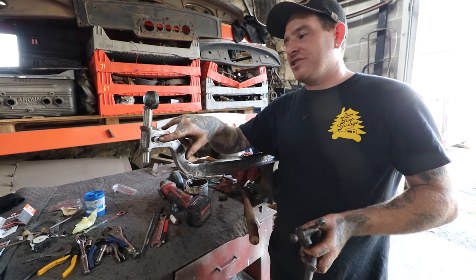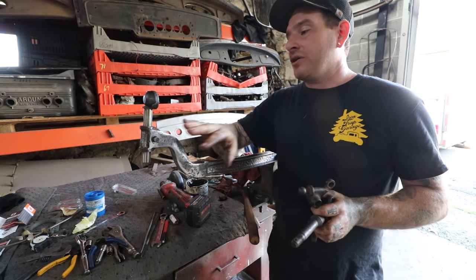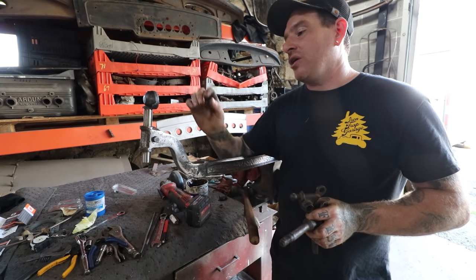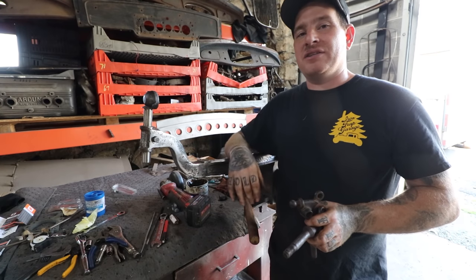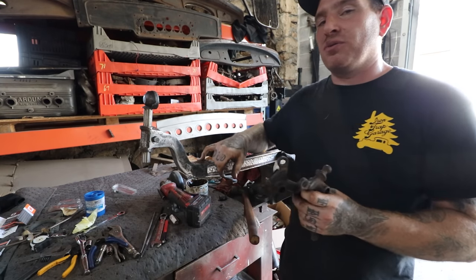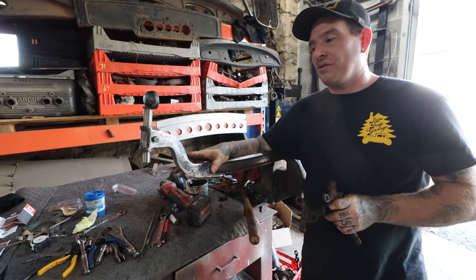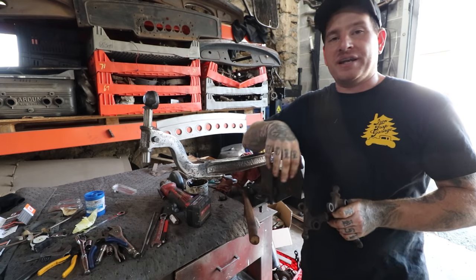I have these wedges here that go in, and they're also the steering stops. Those are supposed to be a very tight fit because it is tapered. So I cleaned them all out really good, and then I tapped them in with a hammer to make sure they went all the way in and all the way out, and everything's good to go. I have all this stuff plugged up so that when I go to paint this axle, we don't get paint down in these areas and cause an issue. But I've learned from previous frustrations, make sure you clean up all these bores, get them nice and clean and ready to go, especially if you're using old swap meet or junkyard find parts like I do. You need to go back and go through all these bores, because a lot of times the bores are either rusty or deformed from heating and knocking them apart.